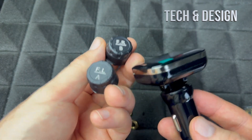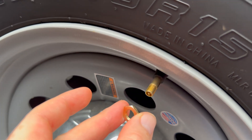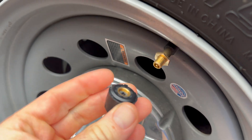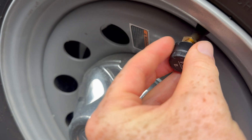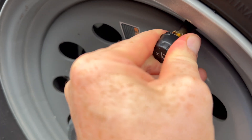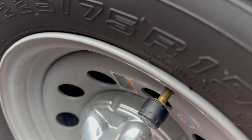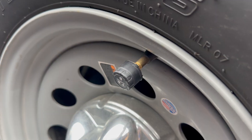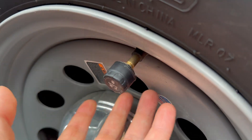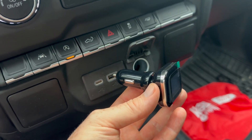From the tire valve, remove the cap, then screw the sensor on. Once it's on, screw on the lock ring. Some air will come out — that's okay, that's supposed to happen. Make it nice and tight, then use the lock ring the other way to secure it. Use both hands to make sure it's tight, then test with soapy water to check for leaks.